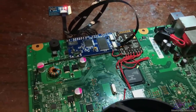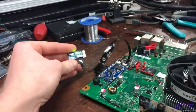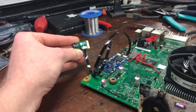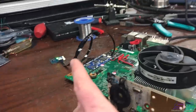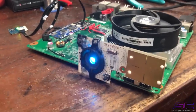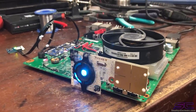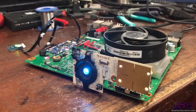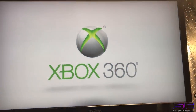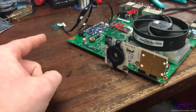So that's pretty much everything on that. I'm going to show you guys how it boots. I've got it wired up right here, the TV is on. Right now we are on the first NAND, which is the retail side. We'll go ahead and turn it on - it should instant boot. As you can see, the chip is not glitching, which means it's disabled. And there we go - instant boot, like a retail should. I'm going to go ahead and turn it off because I'm going to show you that the SMC reset does work.